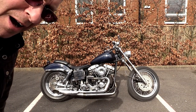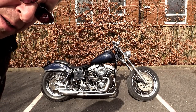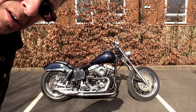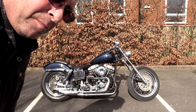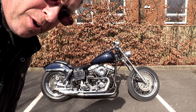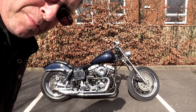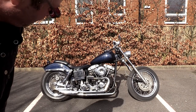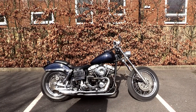This tickover's a bit low and it doesn't do the engine a lot of good to run it low, but as is all the rage on YouTube, people like to get their tickovers as low as possible on a Shovelhead, but I shall now put the tickover back up. So I don't want to starve the top end of oil now, do I?